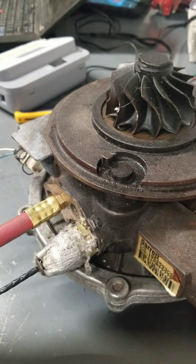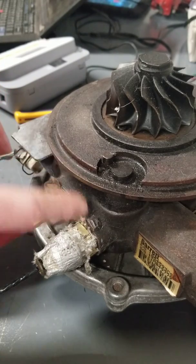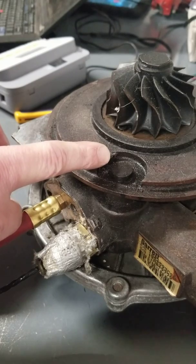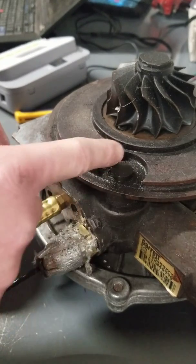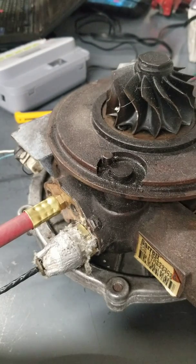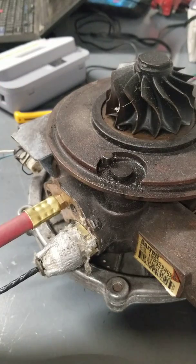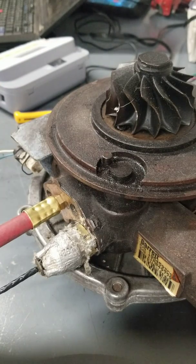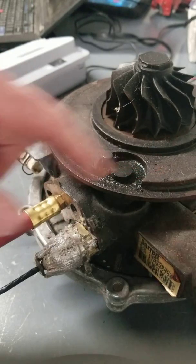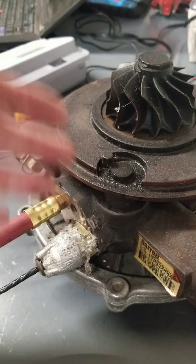I haven't set up the logic yet, but it's just a quick demonstration of basically giving it air pressure and putting voltage on the lines, which is going to move the solenoid open and close, which is going to change the position of the diaphragm, which is then going to open and close the VGT vanes. That sound you hear is me basically just turning the power on and off to the solenoid, and once I plug the air line back in it's going to shoot over, and when I turn the power off it's going to come back — you'll actually be able to see it move back and forth.